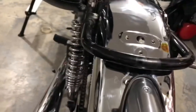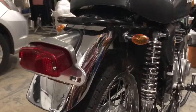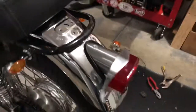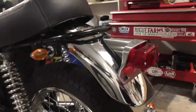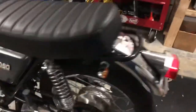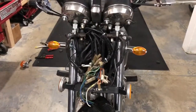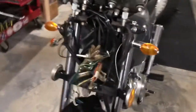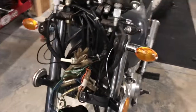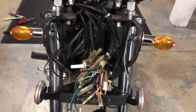Now we move on to these indicators. I already have one off and that's when the wiring becomes fun, so we'll see how it goes. I still have to work out a couple of electrical issues. These indicators wire up just a little bit differently than the factory ones, and as a result they work, but when I turn the front and rear headlamp on the signals don't work. I'll figure that out — it's probably a simple grounding issue or something like that. I'm not big into electrics, so I'll get my head around it and fix it.